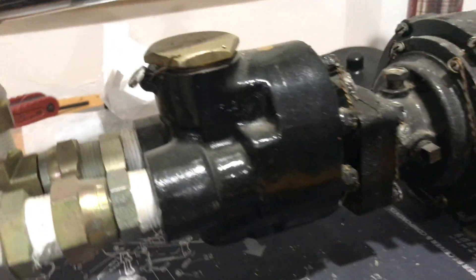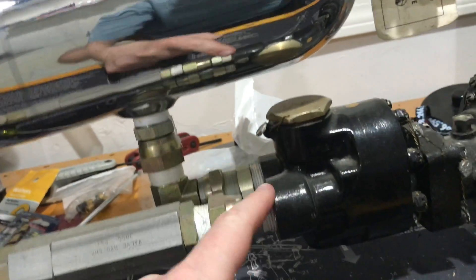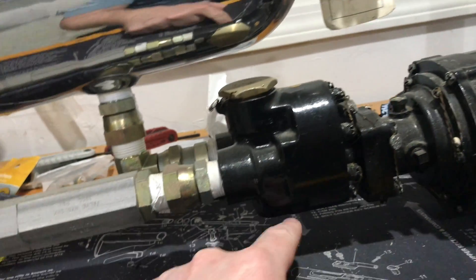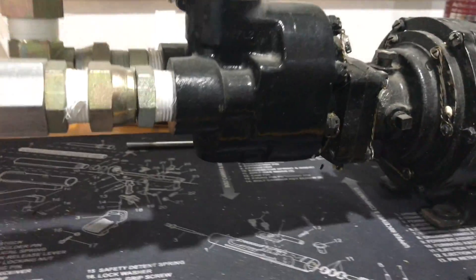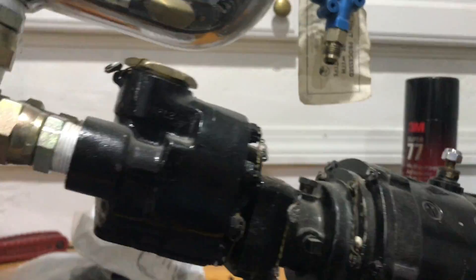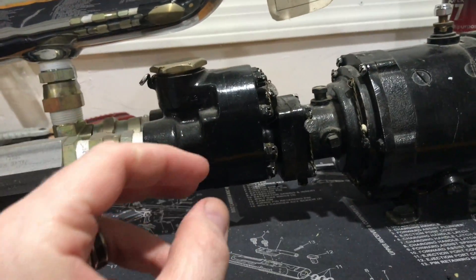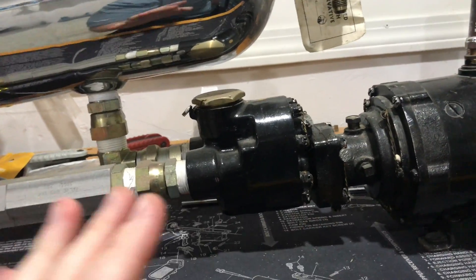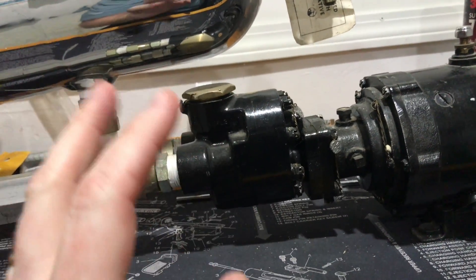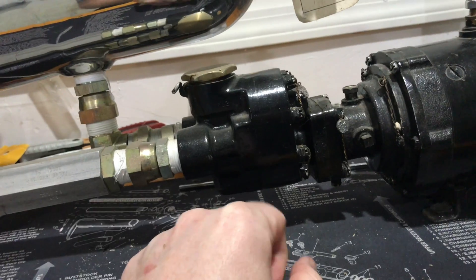Here is the gear head for the Pesco 280. One is an inlet, which is on this side, and then you have your outlet. On the bottom side of the pump, underneath here, there's actually a set screw, and that is for your pressure relief. That is meant to protect the gears in the event that it's over-pumped and the hydraulics can't pump anymore. That basically blows off the fluid, so it goes back to the return. So that's a safety feature built in.